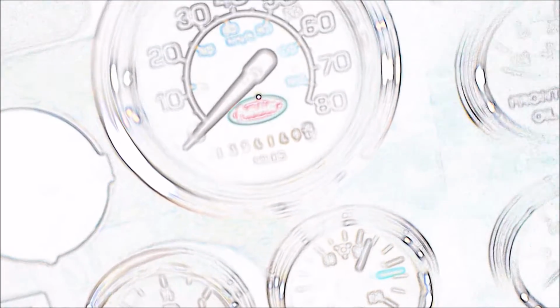We're not really trying to put this truck out on the road. I'm just trying to shoot an educational video, let people know exactly what to look for when they're doing an air system test. Oh, and we're dropping down to about 90, which is well below the 5 psi margin that we had for this second test we're doing. Hopefully it holds at 90.